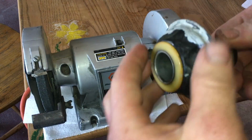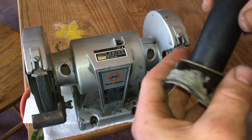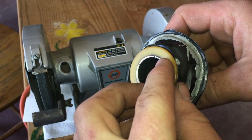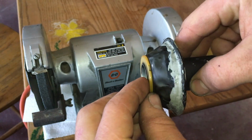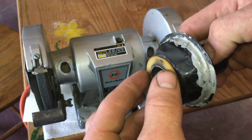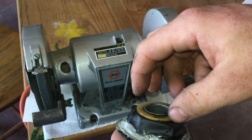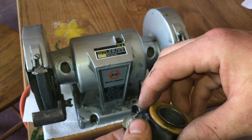You're replacing a rubber diaphragm on a Yamaha Virago 535, 1993. I'm going to grind this edge, this metal lip, right off. Not completely, just enough that this thing takes a little bit to pop off and push back on, and it kind of holds it all together. It actually turns out really nicely.